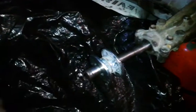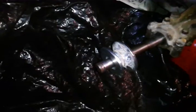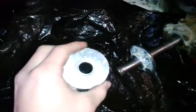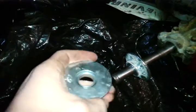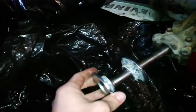I have some extra 3/4 shaft from another transaxle. I'm considering whether I should do a 4-bolt hub with a flange, kind of like this, only it's going to be way bigger, of course. You have 4 bolts with studs on them, and that's what you bolt your tire to. Or I could get an extra length of this and extend it out, and use the existing lawn tractor tire setup, where you have a 3/4 inch bore with a keyway setup, and then a C-clip on the end.